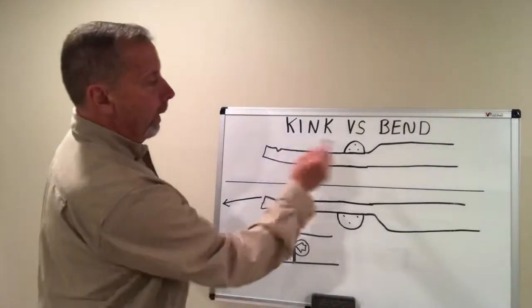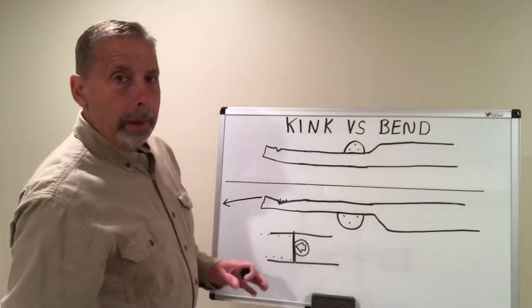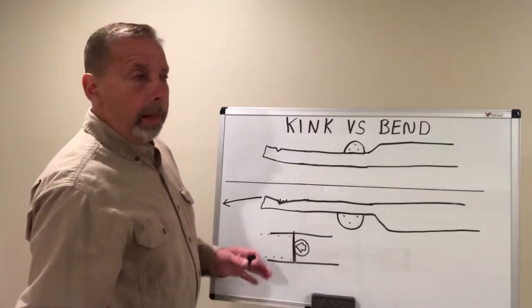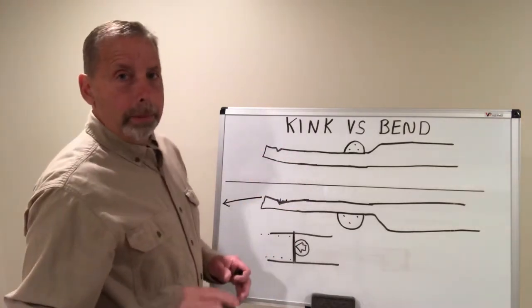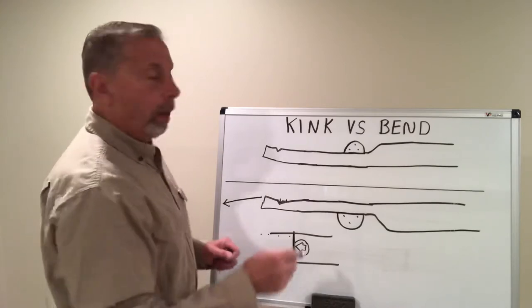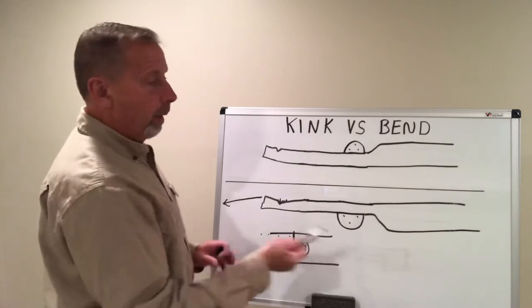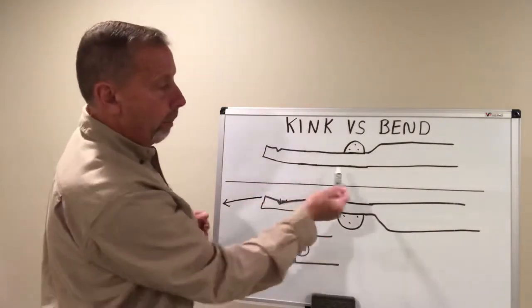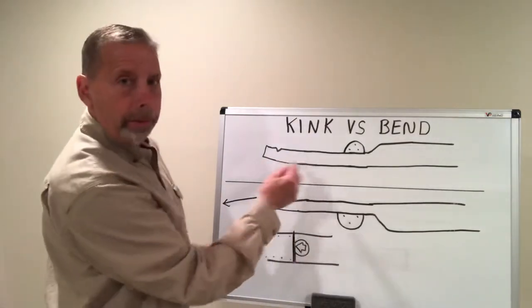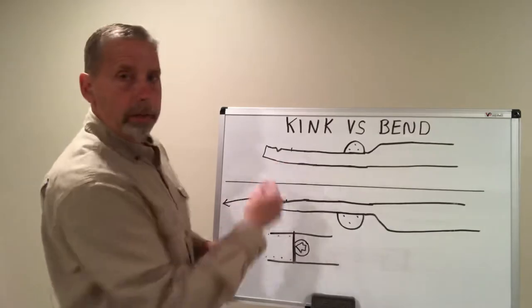So there are a few options, but you have to determine: is it a kink or is it a bend? A lot of times manufacturers say you can't section their rails, but everybody's seen it — insurance company will come in and say we have a sectioning procedure in our program. If they are wanting to section a rail, have that responsibility put on them — the shop and the insurance company. The technician shouldn't be making the decision on what you're going to do with this rail. First you go by the manufacturer, then if you can't put a whole rail in — and a lot of times now with the cost of these cars, repairs and parts prices, they're being totaled out — the insurance companies say we have a procedure and you can section it here. Get it in writing, put the responsibility on them. Don't just say 'I've done these before.'